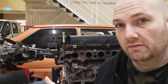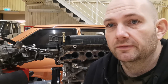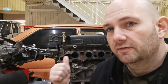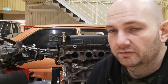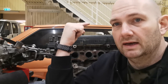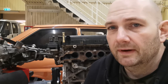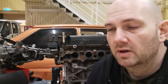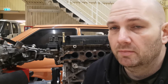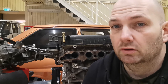Obviously this is a Ford engine — it's come out of a Mondeo, come out of a Ford — so a gearbox does fit it that fits a Ford. The simple answer would be: get a gearbox that fits this engine and whack that in. Well, the problem is that the Mondeo gearbox that fits this engine is a six-speed, which means it's massive and it weighs a ton. It will fit in the car — it will fit in little Alice back there — but she's only got a tiny engine bay. If I start putting a massive gearbox in there I'm going to have to take out probably more of the chassis and have a special bracket made up for the gearbox to fit in the engine bay. All of that's possible, but it's more work than I'm prepared to put into this project just because of this engine.